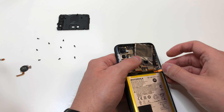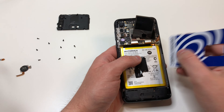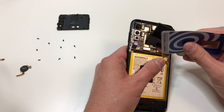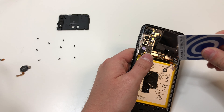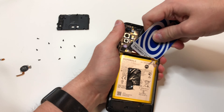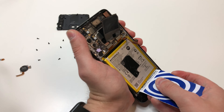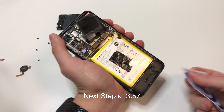Unplug the battery and remove the bottom piece so we can remove the battery as well. Use something like a credit card to cut through the adhesive. Be very careful not to bend the battery — that is definitely not a good thing to do. Use the card to get in there, then use a pick to lift up the right side. The right side is where the screen plugs in, but there is another cable that goes to the bottom so be careful not to tear that cable.